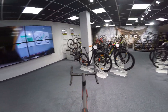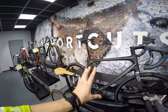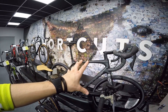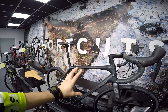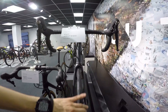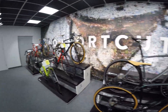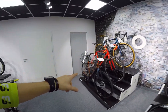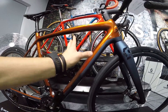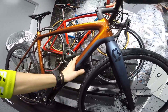Of course, replacing the cables will be more complicated with this system — you know my approach to this. This was the Addict RC. This is the Addict non-RC — the frame set that continues from 2019 to 2020. This is the endurance bike, a more upright position, but still a racing bike — not a recreational geometry at all. This bike in the disc brake version also has lots of clearance for 28C tires, making it a great endurance bike. And then we've got the Foil, which we'll compare in a moment.